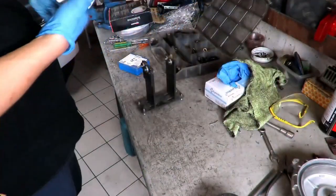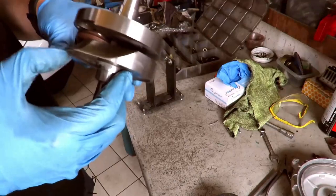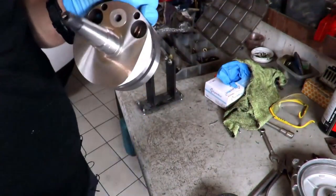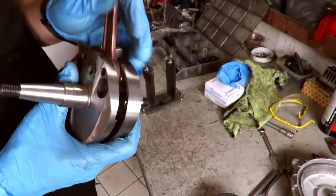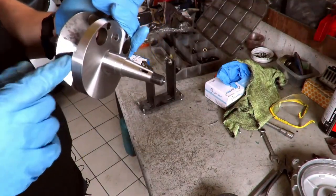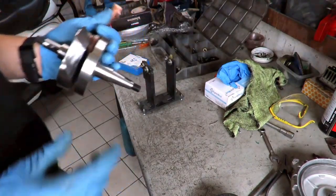Okay, to work. We worked our crankshaft, just as I told you, that is cutting, filing on the side. So, diagonally a little bit, to balance. I've removed some material on this side. Don't be fooled by the fact that I, or even Francesco, well, we work by eye, that is, we go cut just like that, because the references we have are the results of several years of experience and tests, which allow us to do this quite easily. But if you are a beginner, please first measure and then cut. 100 measures, one cut. This should be your motto.